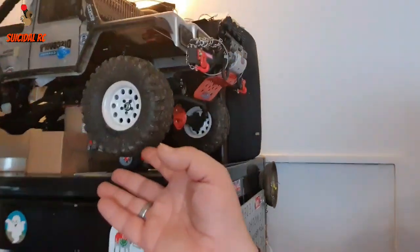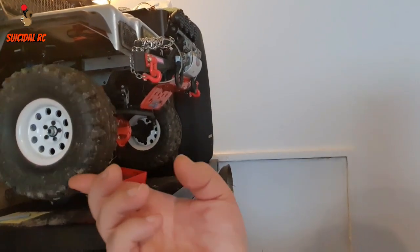The only downside is, it's not really a downside, it's more of your confidence within yourself and controllability. I had to take the drag brake off. The brake's completely off on the 1080 Hobbywing ESC. I had to take it off because the reduction on this is so much. You can see the wheels, I can turn them there. That's because there's a bit of slop in the shafts.